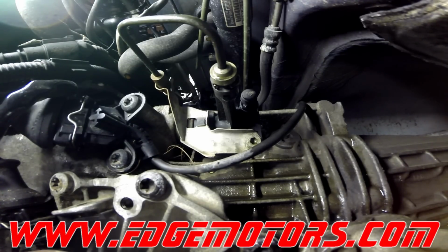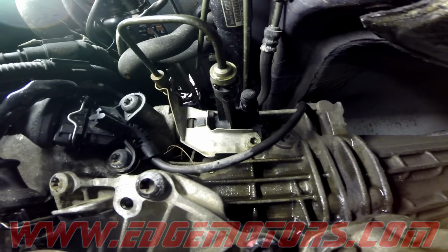the body of the car. The brake fluid doesn't dissolve the paint right away, but if you leave it on the paint, it will dissolve it over time. So make sure you wash all the brake fluid off. You can wash it with water, brake fluid comes off very easy with water. That's about it.